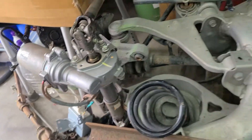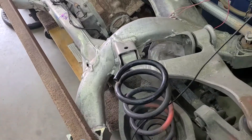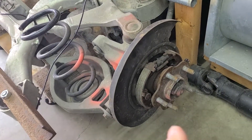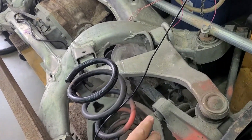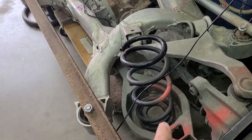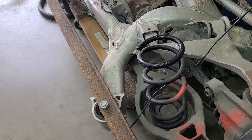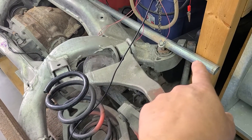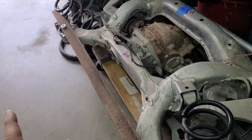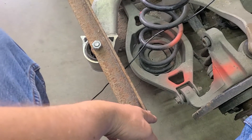The other cool part is this Infiniti G35 rear end. They're extremely affordable and super easy to mount. The bolt pattern is 5x4.5 from the factory. The stock shock that goes up into the shock tower is going to be eliminated — I'll run the factory coils and a center-bolt shock absorber up the middle. The angle iron and galvanized pipe on here are just for alignment. The Jeep frame rails from '46 to '65 are 49.5 inches wide so I made my angle iron that wide.